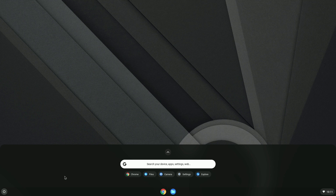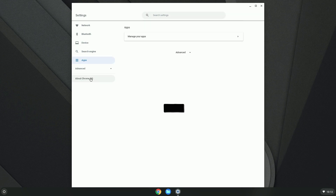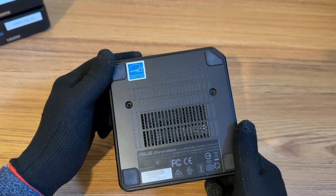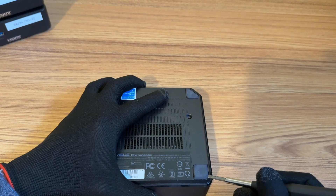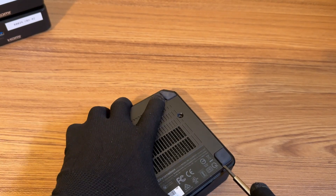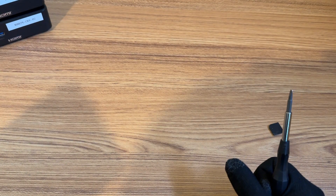So the Chromebox is functioning, but now what I'm going to do is just turn this off and power it down, and then I'm going to see if I can reset this and install Batocera on it. Now, before I do that, I do want to show you the exact processor that I'm dealing with here. This is a Celeron 3215U, and it only has two threads. To get into the Chromebox, you have to flip it over — it has four rubber pads on it — and you just have to pop these off to get into a screw underneath. I will fast forward this part mostly, but keep in mind this isn't going to be a full tutorial, just a little bit of a guide.